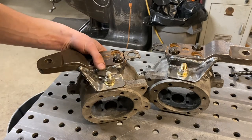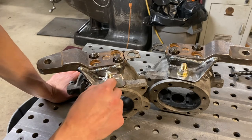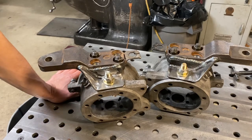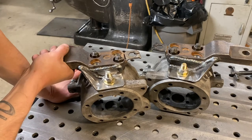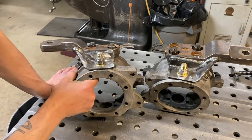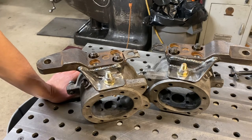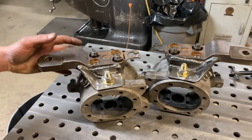All right, I think that's going to be it for this Toyota 5th stud mod. I did have to clearance my weld here a little bit to get my nut and washer to sit flat on the plate — no big deal. Overall I'm pretty happy with the way it came out. The next step is to get these things painted up, get my axle put back together, and get back on the trails. If you're thinking about doing this mod to your truck, go for it. It's inexpensive, gives some extra strength to your Toyota steering knuckles, and you won't break the bank. Thanks for watching.